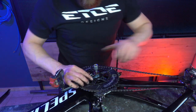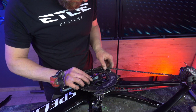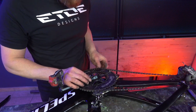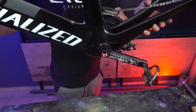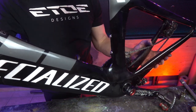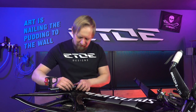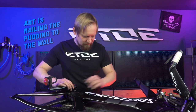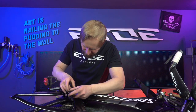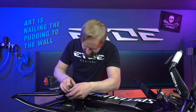And that's all we have to do on the drivetrain side. The last thing to do is adjust the ring on the left side to fit our crankset nice and snug to the bearings. All you have to do is turn the adjustment ring until it's nice, tight and snug, then secure it with the 2mm Allen screw. And that's all we have to do.